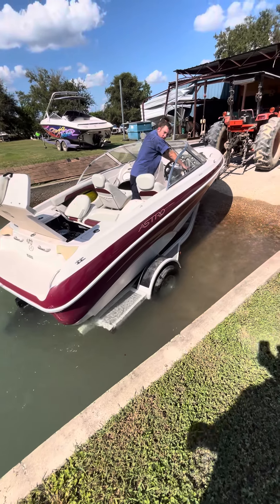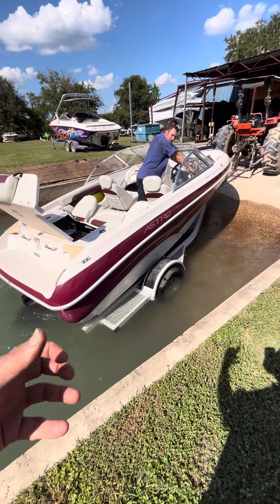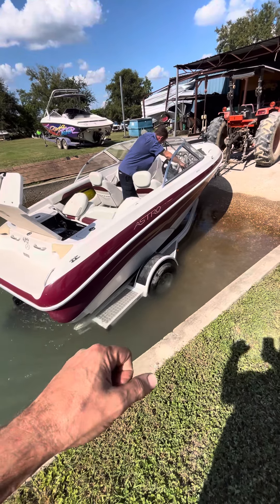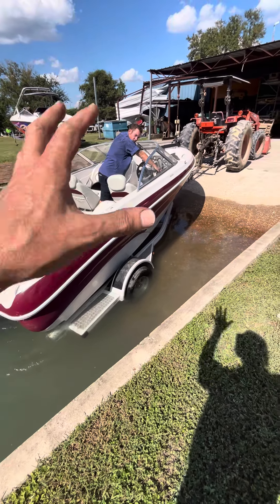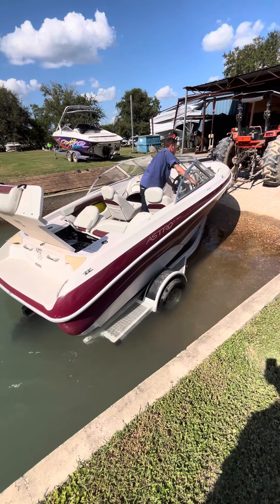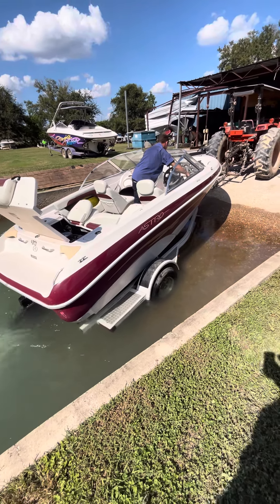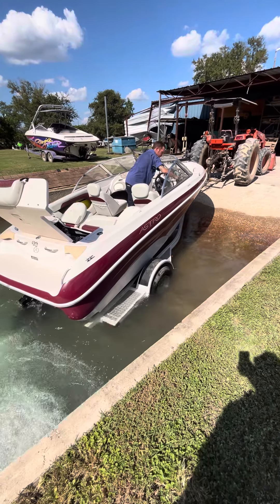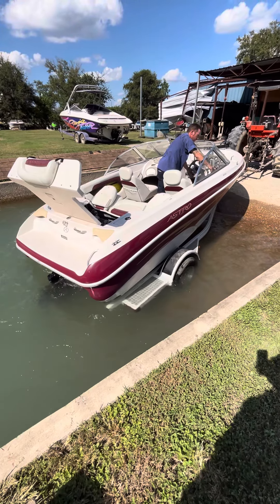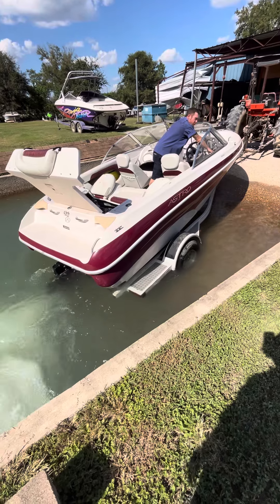Okay, give me full now. Remember when it's full throttle like that in the tank, the boat's not moving, so it's lugging it hard. It's loading up with fuel. So when you chop the throttle a little bit too hard, it's overloaded with gas and the engine will stall on most carbureted engines. So when you bring that throttle back, don't completely chop it — put it up by 2,000 RPMs and then chop the throttle, let's see what happens. So that's your carburetor needing to be rebuilt. He's having to pump it to get it going — that shows the accelerator pump is having trouble inside the carburetor. Okay, now chop it. And it died — that's carburetor. Carburetor needs rebuilt unfortunately. You can not chop the throttle and you can pump the gas to go forward, and it's going to run fine, but that's a classic sign of a carburetor having problems.